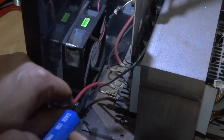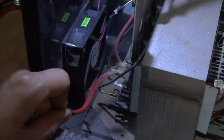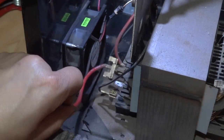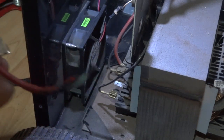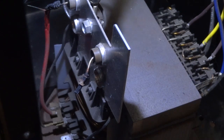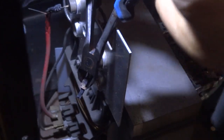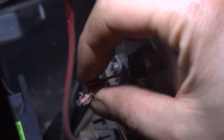always set the charger on high and charge for a minimum of five minutes before attempting to start the engine. This allows the battery to absorb a surface charge so that when the key is turned to start the engine, it is pulling some power from the battery and not demanding all of the starting capacity from the charger. I'll post the PDF in the description.